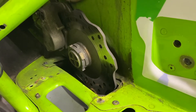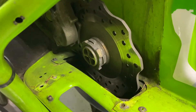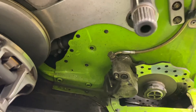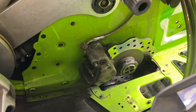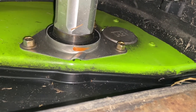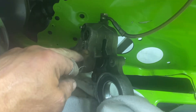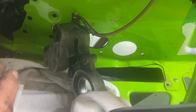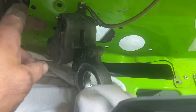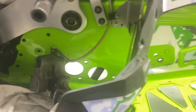I got in here and took those brackets off. Now we've got to take these nuts off in order to get the brake disc off, and then that shaft should just come right out of there. It's a lot easier if you take the secondary off — it's not hard on this sled. This is kind of the bearing keeper on the left-hand side. The screws and bolts have to come out in order to get the brake caliper off. When you are taking this out you have to split your caliper. I hate doing it, but you have to do it to get the rotor off, the brake disc, and this caliper assembly. The only way to get it off is to split this baby. You do get some fluid leaking, so put down some cloths or rags. But other than that it's not too bad. Then that shaft pops right out of there.